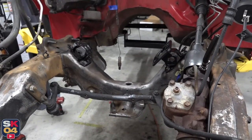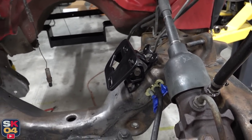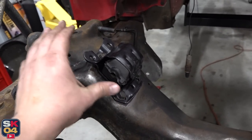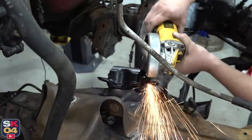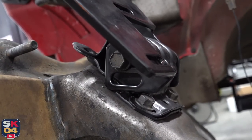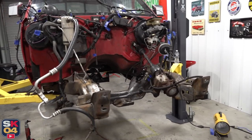I'm not sure if I'm doing this right or not — this is a total learning experience. I have the motor mount adapter plate bolted on the driver's side in the lowest height position. There's some adjustability there, but I need to get the passenger side one on first and then drop the engine down and figure out the angles from there. On the passenger side one, you need to cut off these little tabs so you have the proper adjustability left and right. I also had to bend a couple small tabs near those bottom bolts so the plate will sit down fully. Now for the moment of truth — let's get the engine off the stand, hook it to the crane, and see how it fits.